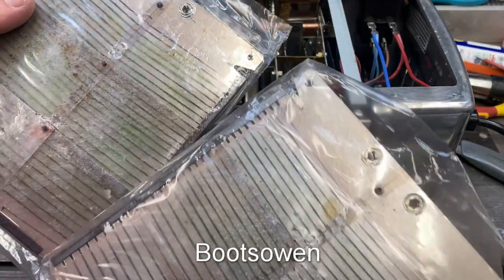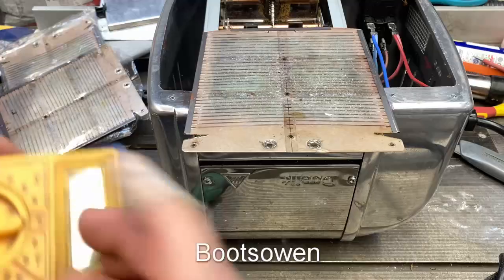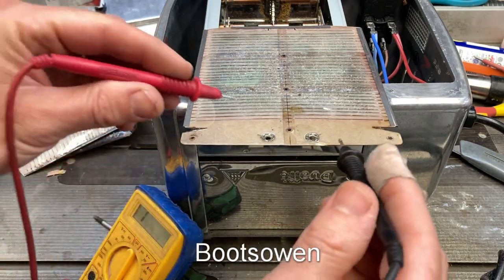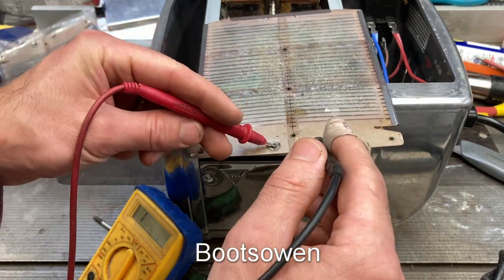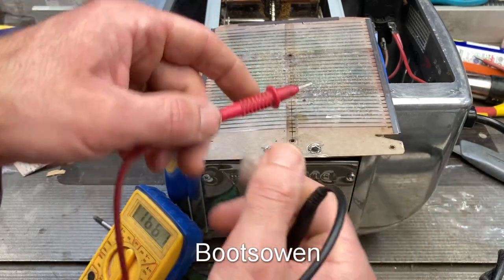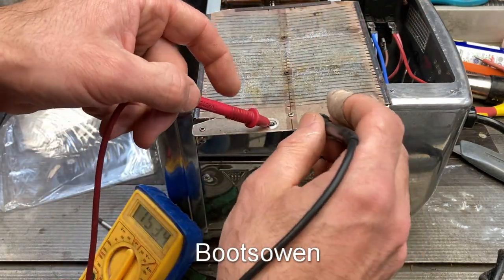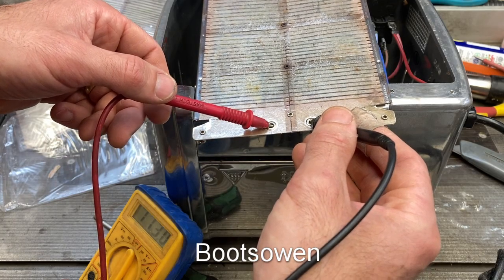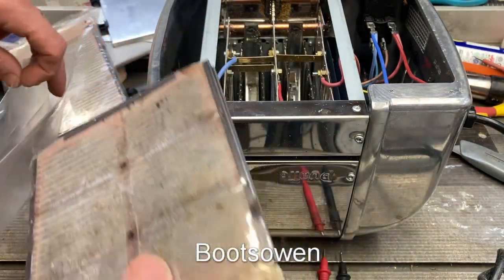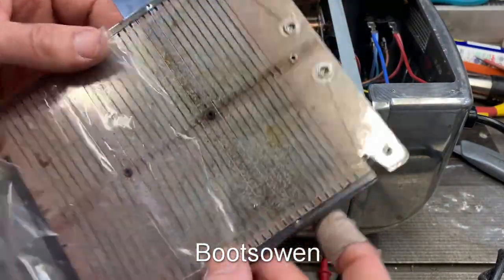Here are the ones I have from previously, and it's hard to say which are good. These ones look better. Let's test the continuity on these ones. Bearing in mind that they're cold, they should have continuity — actually it's the resistance I'm talking about. There's one for open circuit. 143.3 on that one. If I remember correctly, one was an end and one was a middle. So 143 — and this one will be 113. I think 113 was the end one, and 143 was the middle. It's got fewer windings on this side than on that side.